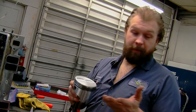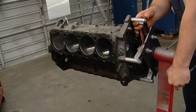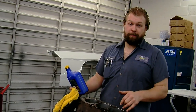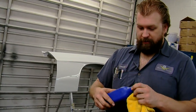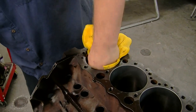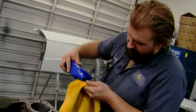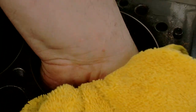I've talked to several engine builders about how best to pre-lube an engine and you get a different answer from each one. When it comes to installing the pistons and rings, I like to take a bottle of generic dinosaur oil, pour some on a rag, and wipe the cylinders down. Once the engine is running, the oil ring scrapes a lot of oil off, so having a whole bunch of oil in there isn't ideal. This approach does the same sort of thing — taking the majority off the cylinder wall but making sure it stays in the crosshatch.